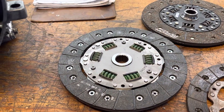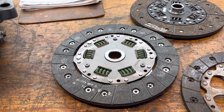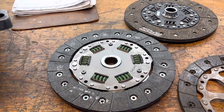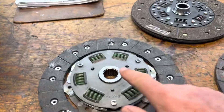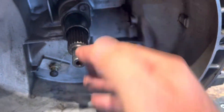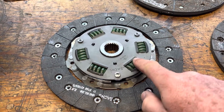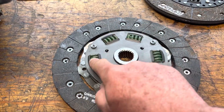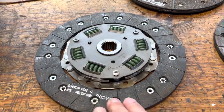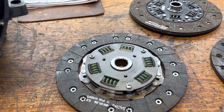While it will work, there's a high probability of failure — you only have about a third of the engagement that the engineer has designed. We did try installing it backwards; it's deeper this way and will go deeper into the transmission, fixing the problem. The challenge is when you try to depress the clutch, the actual pressure plate will impact the springs because they sit up higher than a standard clutch. So you're screwed if you do, you're screwed if you don't.